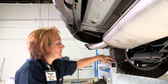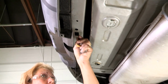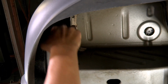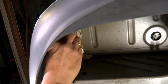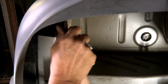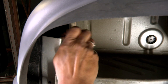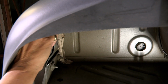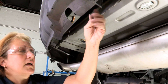We're going to get our bolt together and our washer. We're going to take the line and go through the hole, and it's going to come out the end of the passenger side. And again, you want to make sure you don't pull your line all the way through. Attach your bolt to the end of the fish line by just screwing it in like you were screwing it into a bolt. All right, then you're just going to feed your plate in first. And now you have both your lines.